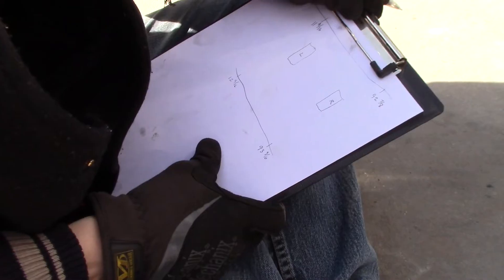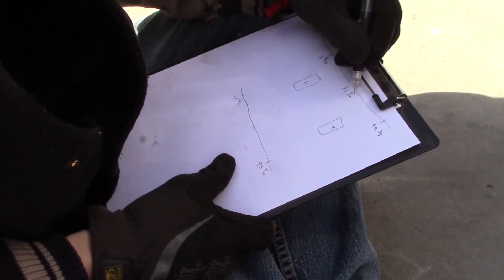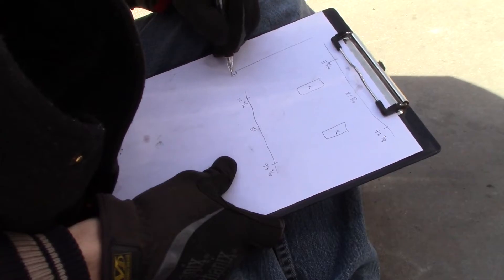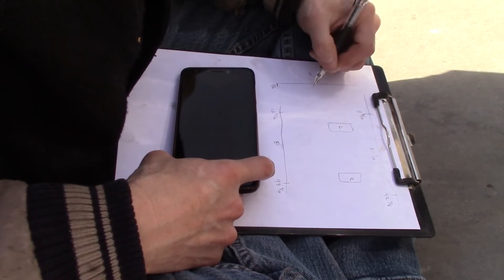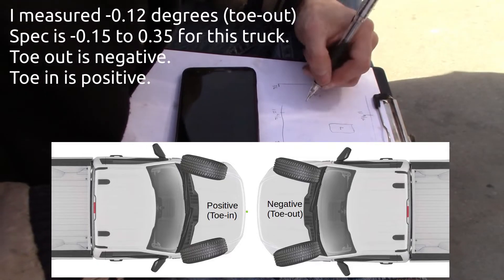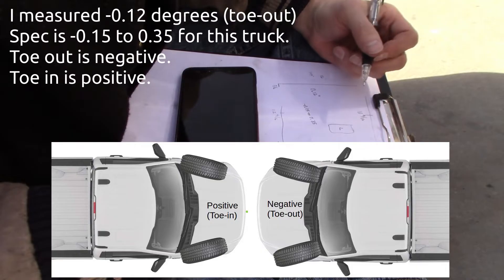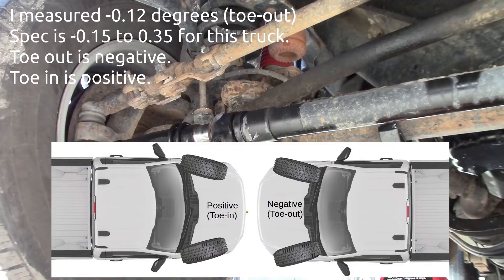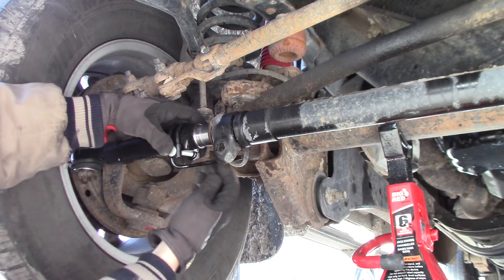I know it's the 21st century now. I've got my left and right wheel here, with distance marked behind and in front. 81 and 5/16ths width for the front, 81 for the back. If you wanted to know the degrees, take the angle whose tangent is 5/16ths of an inch divided by 12 feet — that's 5/16ths divided by 144 — and the angle is 0.12 degrees. I need to interrupt myself: I made a mistake on direction — negative toe is toeing out, positive toe is toeing in. The spec is minus 0.15 to positive 0.35, and I'm at minus 0.12 degrees toe out. So it's within spec — not right on, but we're going with it.